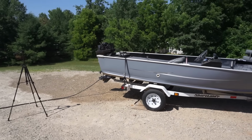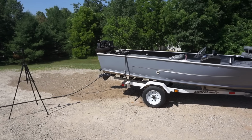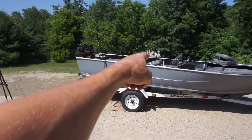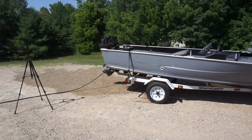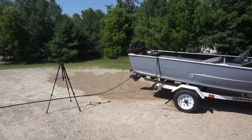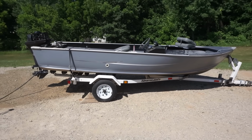And the engine, when we were going full throttle, overheated. And I think it did, at least, because the beeper on the console over here, the throttle control, was just beeping, a solid beep, and wouldn't turn off. And then the engine ran like crap. It sounded like it was running on one cylinder. So today, we're gonna try to figure out that problem.